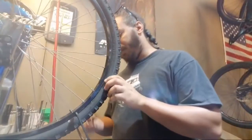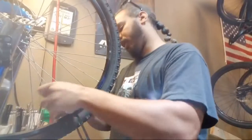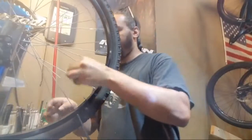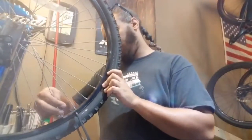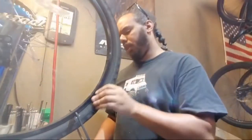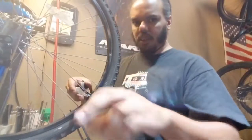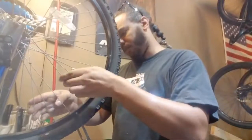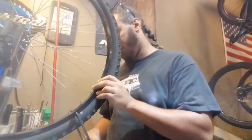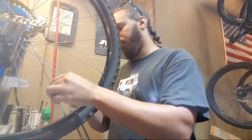Alright, so let's start at the worst part, which is here, and start working our way around. That's actually right there at the new spoke. Let's put some tension on that. We're already a little bit straighter. Oops, dang. There we go. Right here. That's really loose.